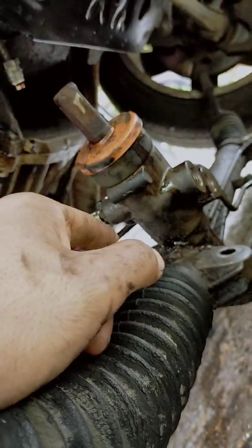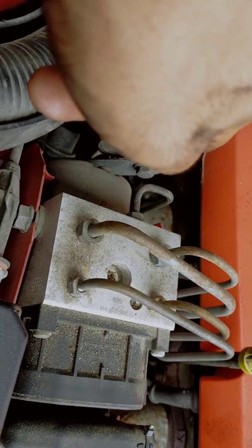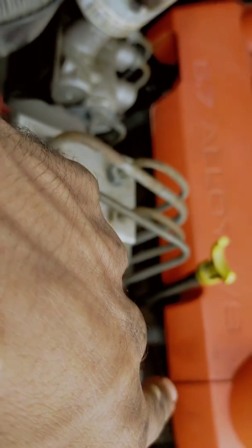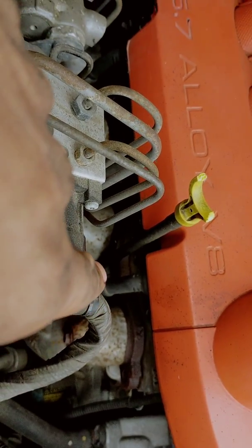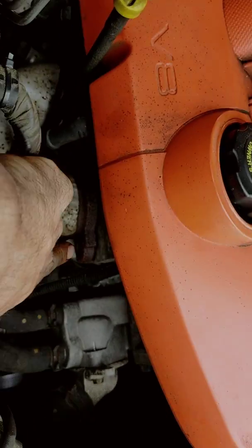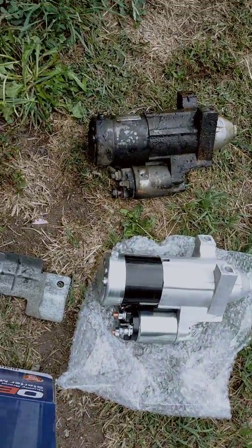I've just dropped that, and obviously you'll have to re-bleed your steering rack, but it's much easier than, as other people have said, doing the mounts of your header. If you take your header off, there's a chance of snapping a bolt, and then you'll have to get the stud tapped and all this stuff like that, or you have to take your heads off, or if you've got someone that's really good, re-drill the stud out to unwind it. See, there's one broken one there that's been broken for a while. And yeah, so now I'm just in the stage of putting the new one in.